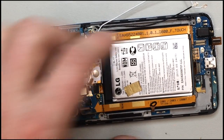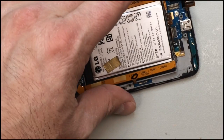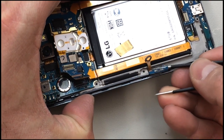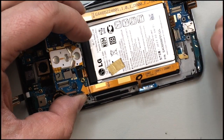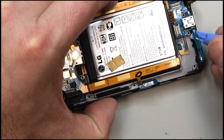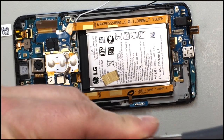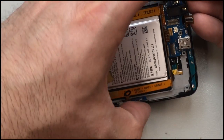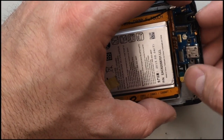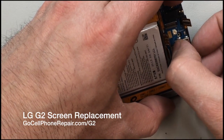You can lift this whole thing back, but be careful on the side — we need to heat this other piece up and pry it away from the mid frame. These cables are very easy to tear if you're not careful. Get under the adhesive and free it. Everything is kind of routed a particular way at the bottom, and we're also going to get under this little piece next to the charging port, very carefully pulling it away from the mid frame as well. Take your time — it has a few cables routed in a very unusual configuration. You've also got your microphone down at the bottom which may have some adhesive behind it, so be really careful when you pull that out.